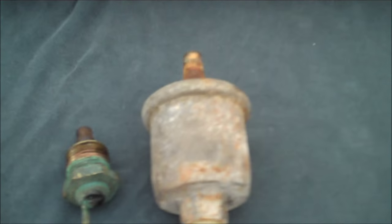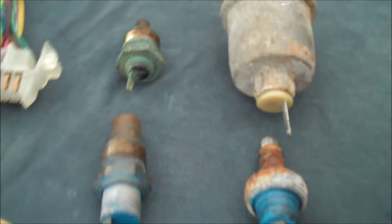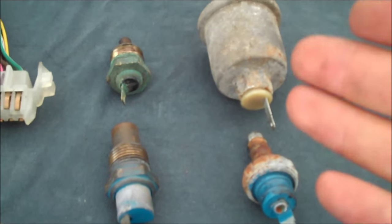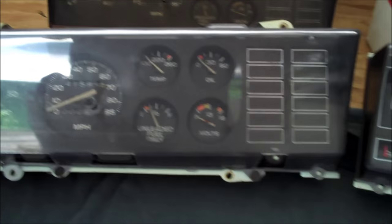Secondly, the sensors — big difference. You can see the physical size difference. Here's the temperature sensor for the rally pack and the temperature sensor for the standard. Here's the oil pressure sensor for the rally pack and the oil pressure sensor for the standard. The reason you have to change your sensors is because the standard cluster just has dummy lights while the rally cluster has physical gauges. The type of sensor used operates the type of gauge used — these larger sensors are a must to get the analog gauge to move, whereas the small ones just trigger the dummy light on and off.